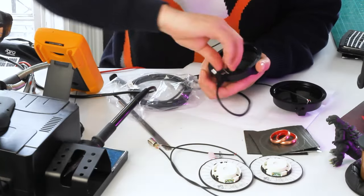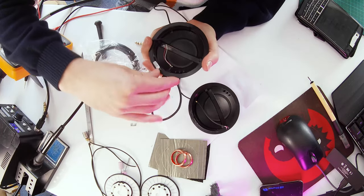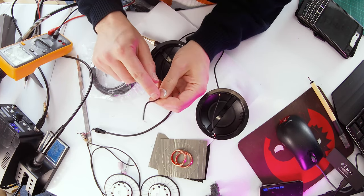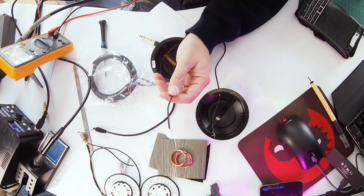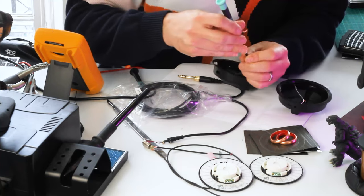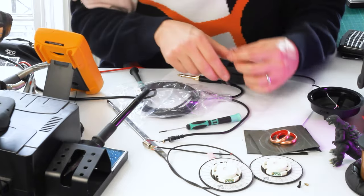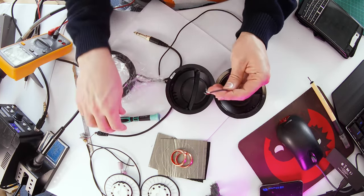Next we want to remove the original main cable. There's a metal clip in there — pull on that to release this cable and get the other cable out. The headband cable has little brass crimp-type things on there. Get a small flathead screwdriver, poke it in, loosen that up, and save these because we'll reuse them. There's also a little rubber grommet on there — save that too.